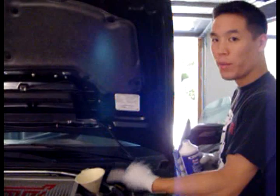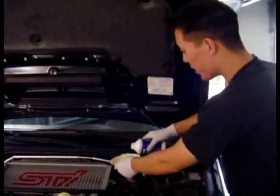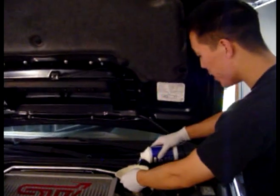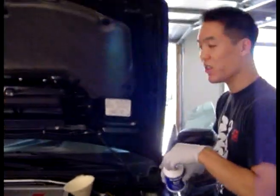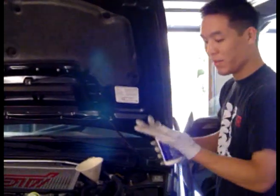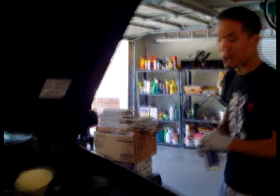Make sure that after every time you pump one of the calipers, you add more brake fluid to the reservoir — because you don't want to be low on brake fluid. Like I said before, you don't want to go all the way down because if you get air into the brake system, your brakes are basically going to fail. So make sure you have plenty of fluid in at all times.